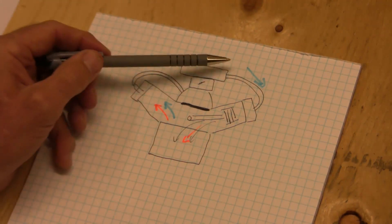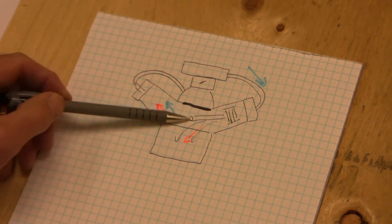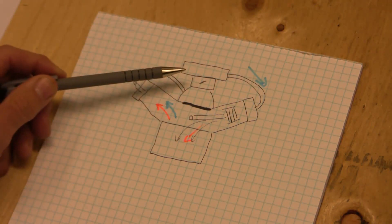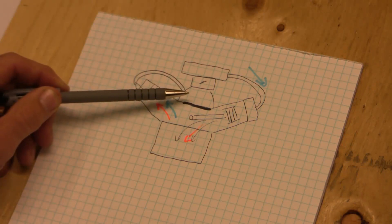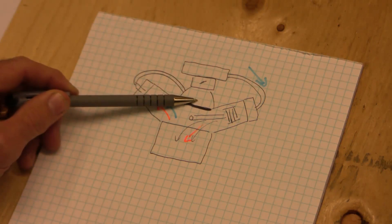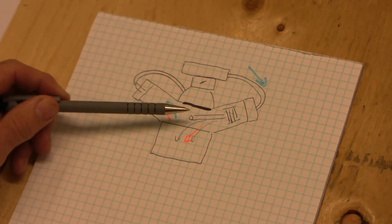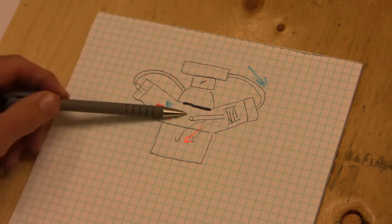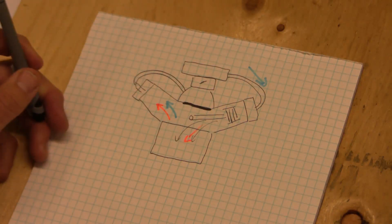Here's what we're going to do. We're going to pull off the breather hose right here and attach a vacuum gauge to measure vacuum in the crankcase. Then we're going to disconnect the PCV hose right here and plug both ends so there's no connection between the intake plenum and the crankcase. I'm going to start the engine and we're going to see if we get manifold vacuum here. If we do, the plenum pan gasket has failed.